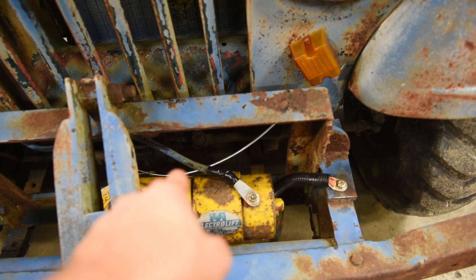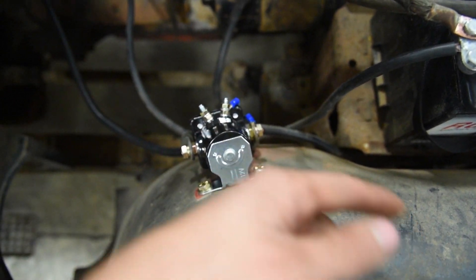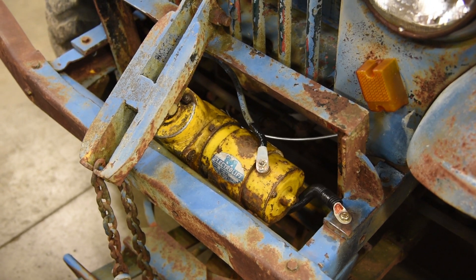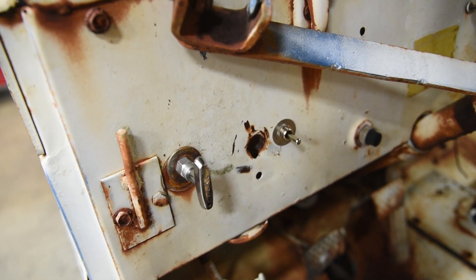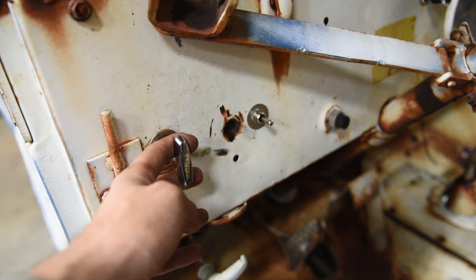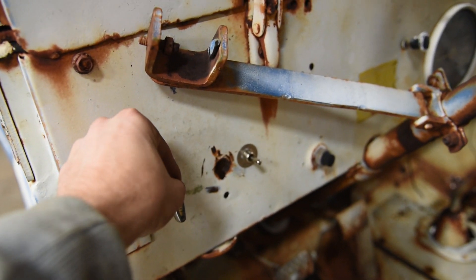You've got two wires: a power wire and a ground wire. The ground can go anywhere; the power wire goes to a solenoid up here on the fender, which I also had to replace since the old one didn't work. Power goes to one side and then it's just like a starter — you turn a key switch and the starter motor turns. And that is indeed a starter motor off of a Willys truck. To go up it uses the motor; to go down it's actually a gravity-down system. There's a little piece that twists — ideally you hook the cable to it, pull the cable on the dash, it pushes this, and the pump gravity feeds down. So you have the plow up, then pull this cable for it to go down — kind of awkward with two different switches. Back in the day they had one big switch where pulling it was gravity down and pushing it activated the switch behind the dash, but unfortunately I don't have that.